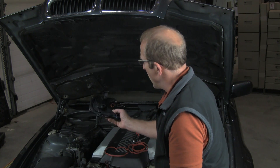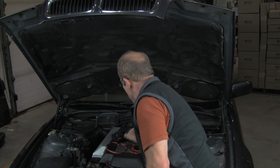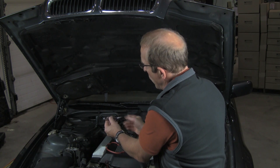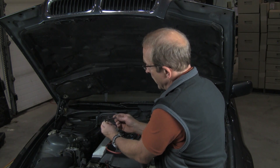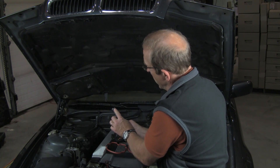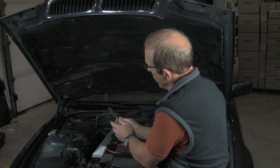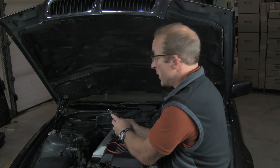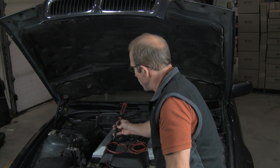The parts needed are just the valve itself, the gasket for the rear, and a specialty tool we've devised to be able to replace the valve without replacing the whole manifold — which is the way a dealer would do this. We have a ratcheting box end wrench here with a short Torx bit. I've temporarily glued it in with just a drop of super glue to help keep it from dropping and losing the bit. This is a Torx T30 bit. We'll also be using the flexible hose clamp driver.